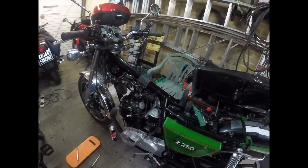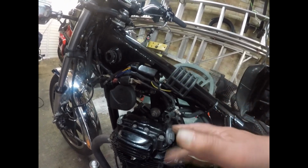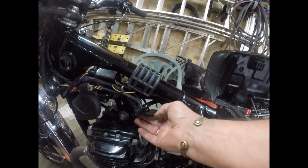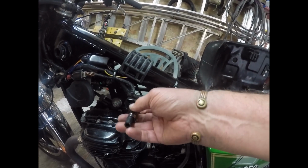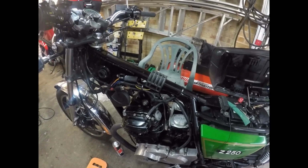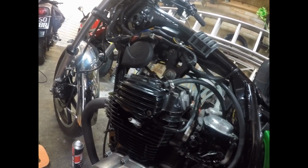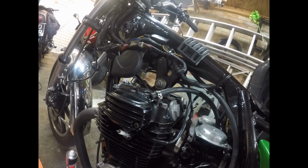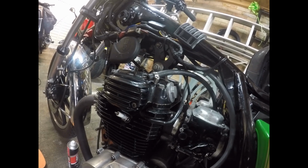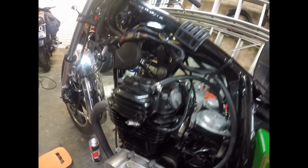Right, we've had a good tidy up, checked all the connectors, rerouted a few bits of wiring, as you would. Not sure that should go there, but yeah, just tidied up, and it turned out there was a wire just pulled out, literally as I possibly thought. So I managed to reposition this and extend it, so we've got a little bit more. Had to replace a couple of connectors and tidied those up because they were struggling, not enough wire on them and too much resistance in them, so I'm trying to give it the best chance I can.